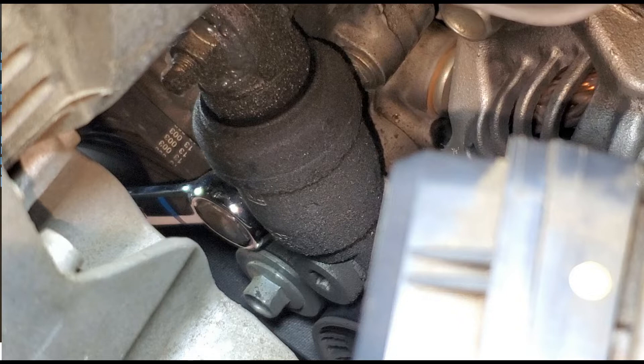The belt is starting to slip. The other thing that can also go bad are the bearings in the belt tensioner pulley. But in our case, the pulley bearings are good. The unit itself has leaked oil and can no longer hold the belt tension.